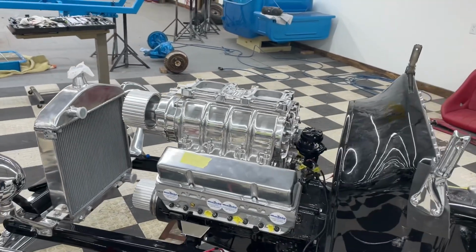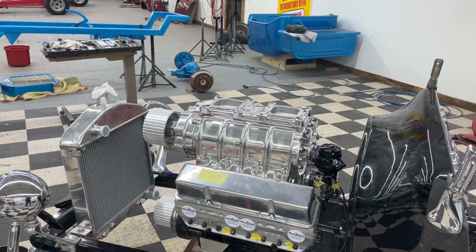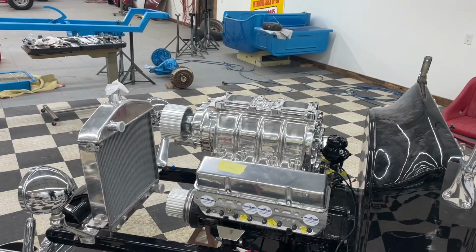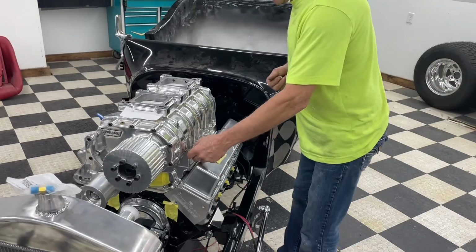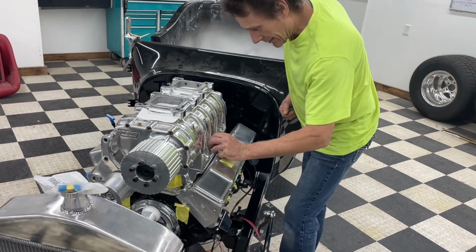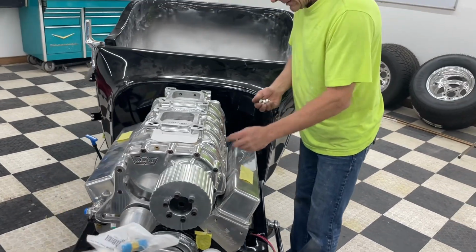Well, I got the baby powder, just waiting for you. The intake manifold's on it, and I checked, it had silicone, so it's been on there. I figured I better just check the torque on these things. They were all loose. We'd have had antifreeze leaking. Okay, check everything as you go. All right. Good to go.